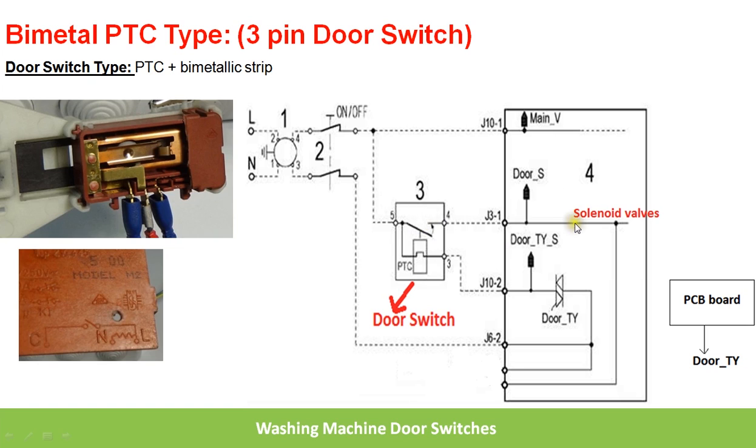This heating time is around six seconds for this switch. When the contact is closed, the voltage is applied to the further electronics and at the same time the door will be locked. After completion of the cycle, or whenever the power fails, the door switch will not immediately unlock. It will take a certain amount of time for the bimetallic strip to cool — around two minutes — and after that time this switch will unlock the door. So this switch does not instantaneously open the door; this point needs to be noted.